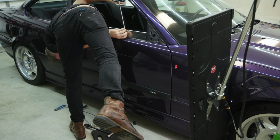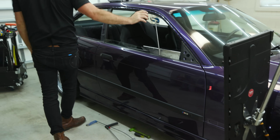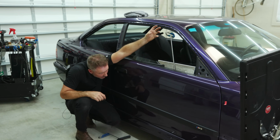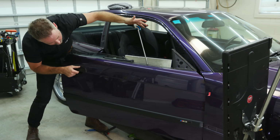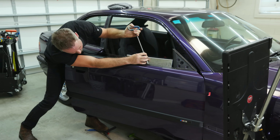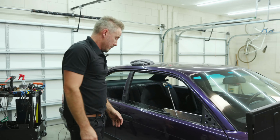Gotta get your eyes down that line. It's the only way. If I go into this position like this, I could open the door, and then I could come in like this, and I'm in this position, which is easy. But because now the light is closer to the dent, watch how I back that out and the light backs away. What's called flooding means the light's too close. So this is where a technique comes in, identifying orange peel issues, and then you can manipulate the light. Yep, orange peel helps.